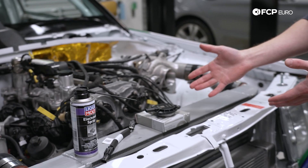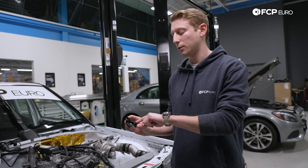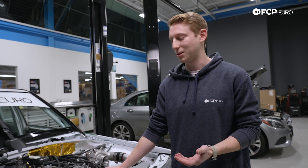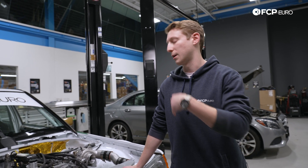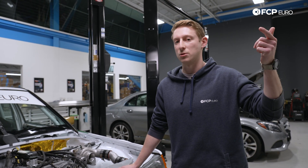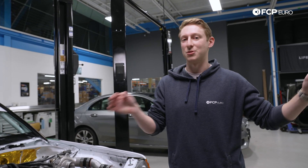The issue that's popping up on all these engines is kind of more common in the M278s, probably because of the increased power that the turbochargers are delivering. What ends up happening is oil flows up as this seal in here fails, up and into the wiring harness. Originally it's not typically spotted — there's not really any clear signs. But eventually you'll get a check engine light for something like an ignition coil or an oxygen sensor. People bring the car to the dealer, the dealer inspects the wiring harness and finds a massive amount of oil accumulation that can sometimes even reach the engine control unit. The outcome is a replacement of not only the full wiring harness itself, but also all of the sensors and solenoids that have been fouled by the oil.